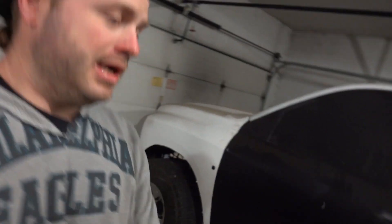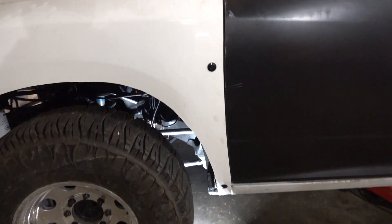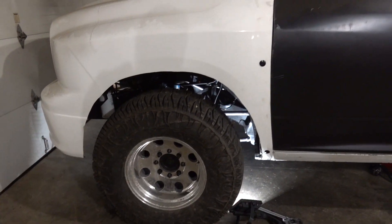I don't think it's going to cause any issues. It clears the oil pan, it's lighter, and we didn't have to move the axle — which even with 35s shouldn't be an issue. We may have a slightly limited turning radius with this setup, but we're not going to be making sharp turns with these tires on the truck. If we ever decide to move the axle or lower the truck, everything is adjustable — control arms, track bar, all of it. Just checking off all the little boxes of stuff that needs done. Hope you enjoyed — please subscribe, like the video, hit the bell notification icon, and get out in your garage and get the wrenching on your truck.